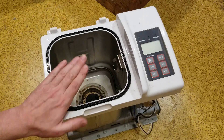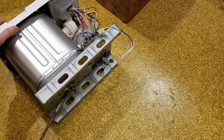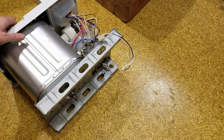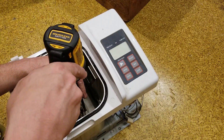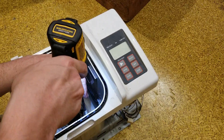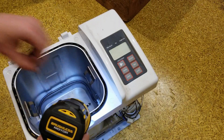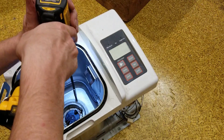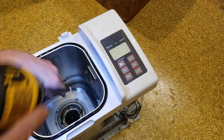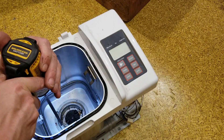A lot of the assembly is the screws that hold this main bucket down into the bottom plate. You have to remove the large pulley from the bottom plate, and as soon as you do that you'll finally be able to get this bucket up. No service manual — these things are just kind of obvious. Impact drivers are great for these types of screws, especially since these screws have been in an oven and can be really jammed.